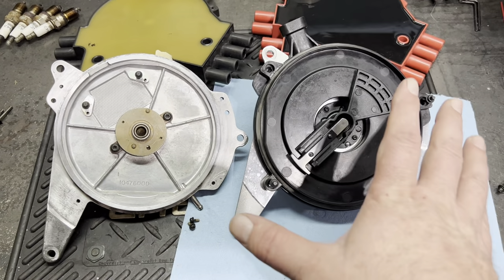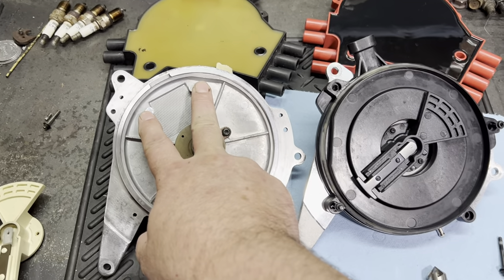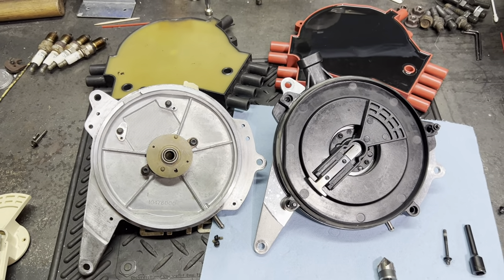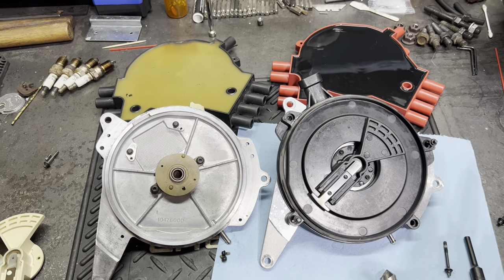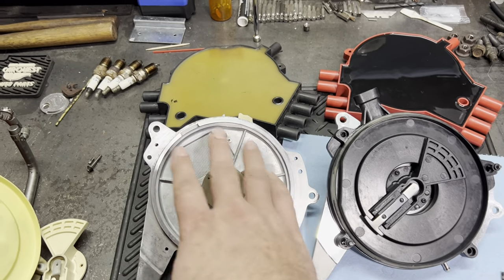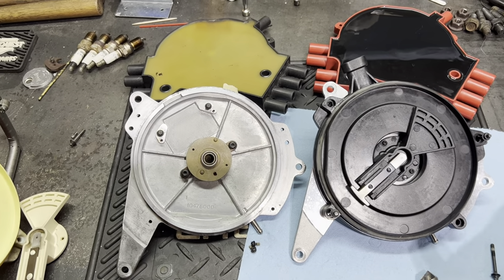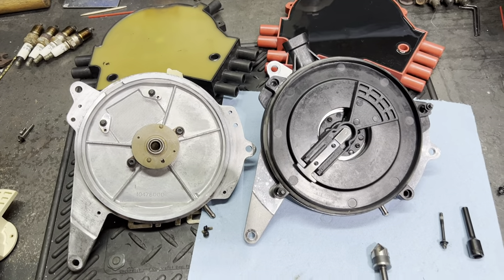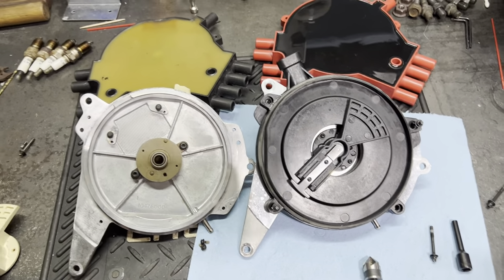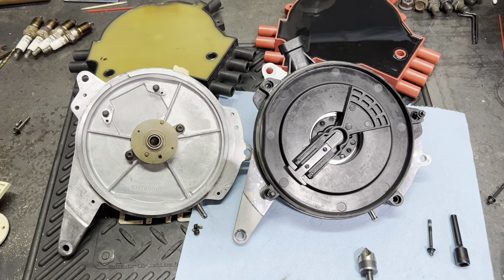You could buy this cheap one — that's one other thing. If you have a good original Mitsubishi optical sensor, or one with low enough miles, you can buy one of these for about 50 bucks, take all the pieces, or just buy cap and rotor if your Mitsubishi-made optical sensor is still good, and put all new stuff on the stock base. This car only has 50,000 miles on it — I should have just not inspected the cap and I would have been fine.